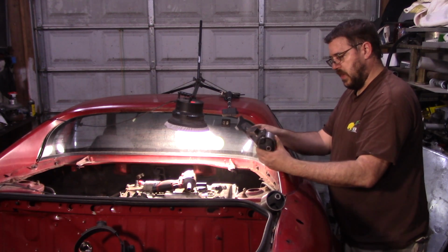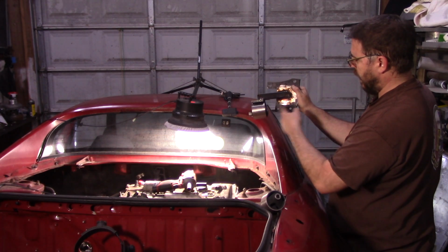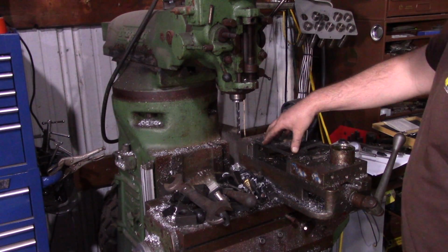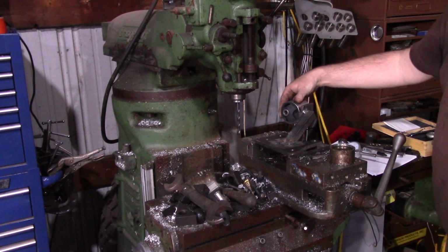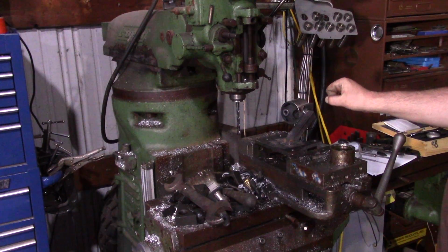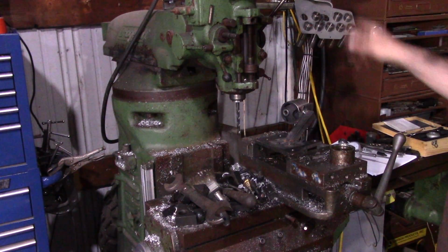Some of this is going to be a bit annoying since this bolt here is right in line with these bolts, but yeah, I've got some ideas. So now that we have this lovely part here that tells us where all of our points are, along with where our bushing needs to be, it's time to just digitize all of these points so we can put them in the computer and design a model that fits all of this and get that manufactured.